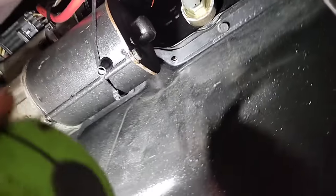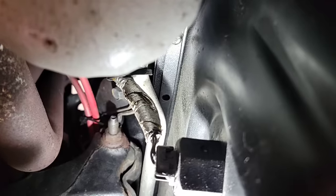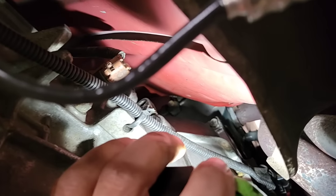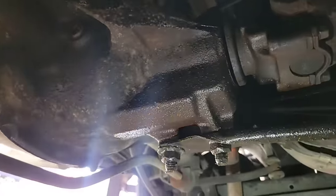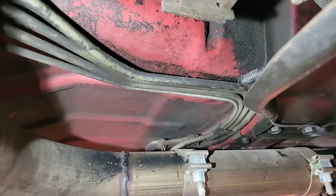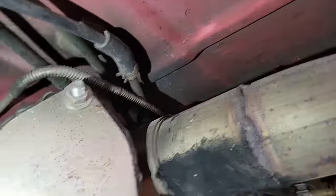There are some issues — missing an oil pan bolt here and on this side. That one up there is missing too. When he first brought it in, we checked her out — that bell housing bolt up in there was just dangling in the breeze. Same thing down here with the torque arm. These cars have got that arm that links from the tranny to the diff to keep everything locked solid. These guys were loose, just rattling around. It's got cutouts, and they're hitting the floor every time you rev it up. And if you like to boil your hot dogs, your gas is getting boiled with the lines that close.